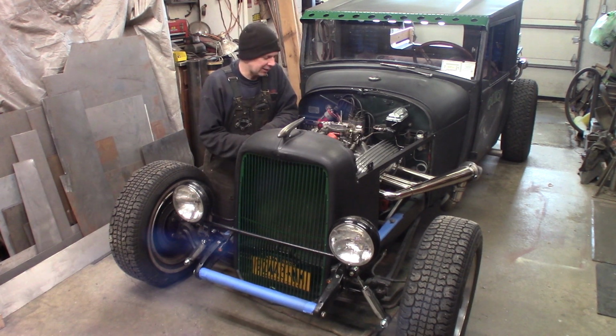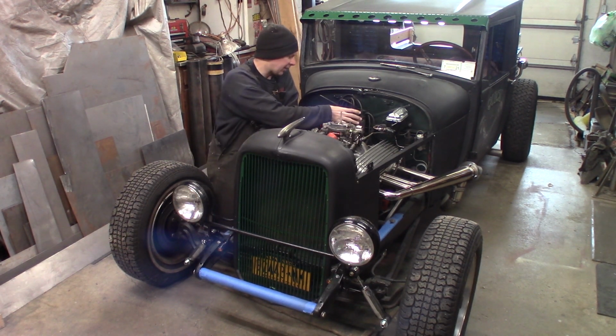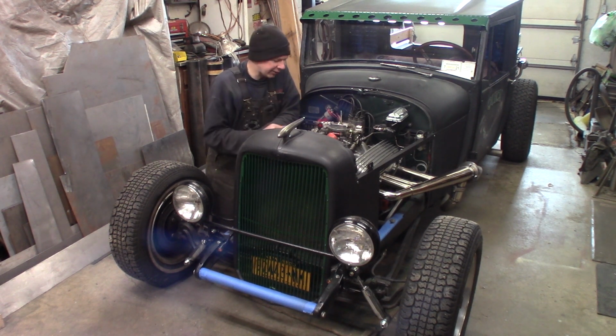Well, today's the day I wanted to do the first drive video, and what I did last night is I got the truck fired up and I threw a little bit of gas in it, and I was taking it around the corner of the gas station and it was getting nice, and so I wanted to do one more lap around the block, and the idle was a little fast, so I got out and I turned the distributor. It also pinged a lot, so I knew the distributor was advanced a little bit, so I retarded the timing, settled it down a little bit.